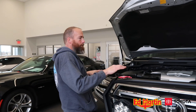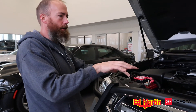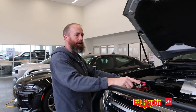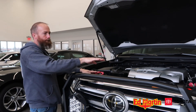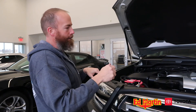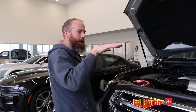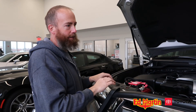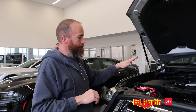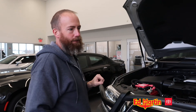With the 212D we're actually monitoring both batteries. So if this battery is low and the truck is off, it's going to charge through solar. Once this gets to 12.7 volts, it's going to turn on the 212D to top off the other battery. Once you're driving, you're going to charge with the BCDC, but it's also going to connect the two batteries with the 212D to keep everything topped off completely. So we won't have any dead batteries — whether we're on the road or at camp with the solar on, we're not going to have a dead lithium or a dead crank battery. We keep those topped off all the time using that 212D.